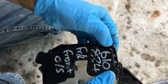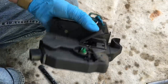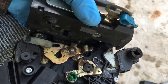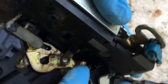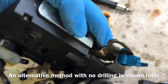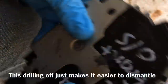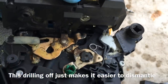I know this plastic cover comes off first, and last time I had to drill out a rivet which is a bit of a pain. Let's see if there's an easier way. That plastic cover does indeed just unclip off. Looking at this, we can see we do have to drill off this little bit of compressed metal on the top and bottom - it's effectively like a rivet securing this plate. This plate has to move out the way to get the lower cover off, as the plastic goes all the way around. So drill that, take that spring-type washer off, undo these screws.